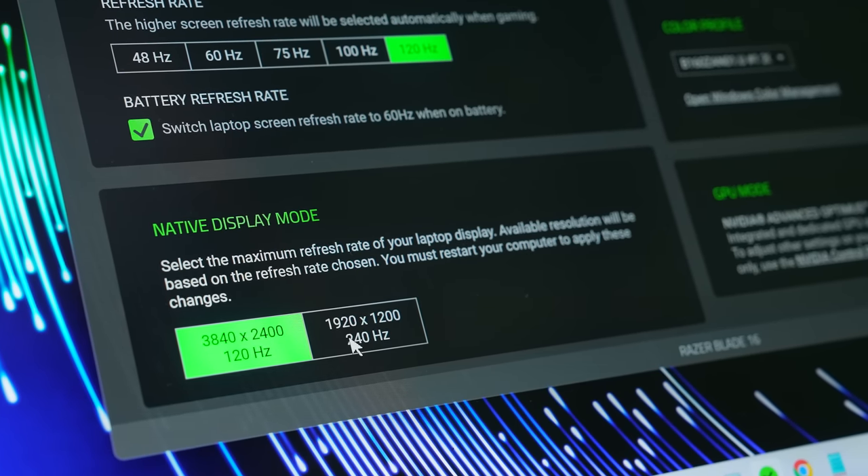However, you need to reboot to swap between them. It's kind of cool because normally with a 4K 120Hz screen you'd be stuck with it — normally if you set a 4K screen in Windows to 1080p it'll still have the same 120Hz maximum refresh rate, but now you can do 1080p 240Hz and get the benefit of that higher refresh rate. I'd probably just keep it at 4K 120Hz and run games at 1080p 120Hz if I wanted the extra FPS boost, and maybe one day like Advanced Optimus it won't need the reboot.